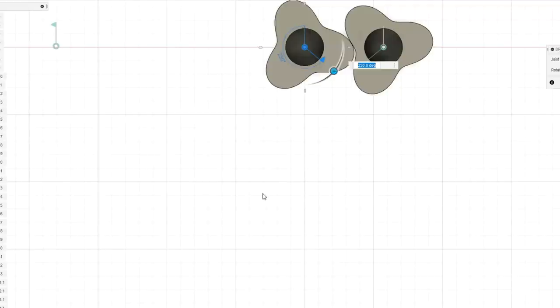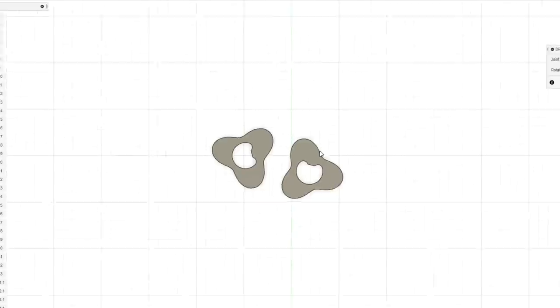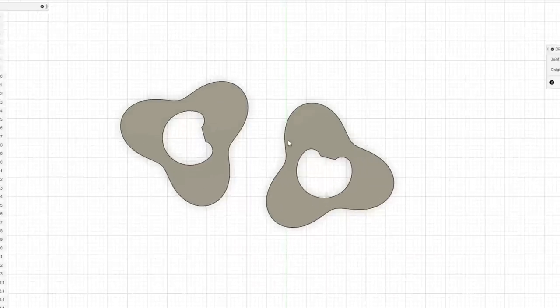But the only difference between the gears we're making for this pump and the gears we made for the E55 is that these ones are not press fit onto the shafts. They're going to have this little cut on them, and the shaft is also going to be shaped like this so that these gears can be slid on and off easily, so that the pump is easier to assemble and disassemble. So that's pretty much everything for the design. Let's get to making all these parts now and see how they function.